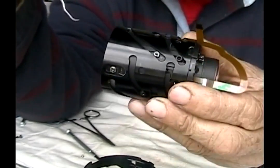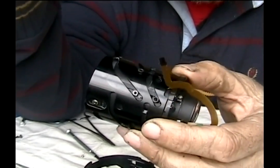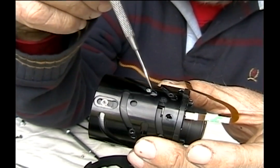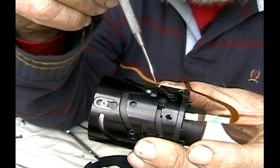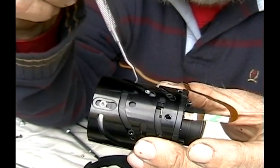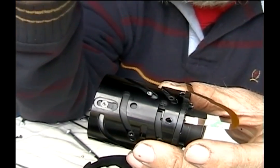I fought and fought trying to figure out how all of this comes together. These little brass fittings go in first. The one that gave me the real trouble was this little metal piece right here — there are three of them, and they fell out. They go in with the slide part; they're about three-eighths of an inch long. This end faces the front of the lens and slides in a track right here. They're quite difficult to get in because by the time you get one in and rotate to put the next one in, the first one falls out.